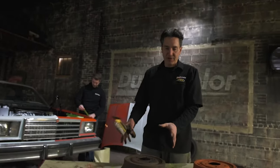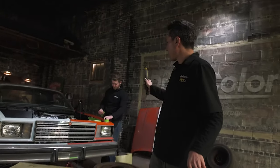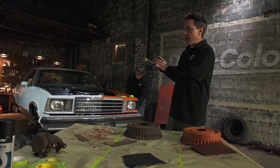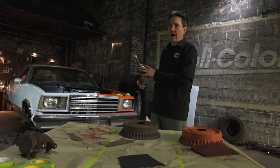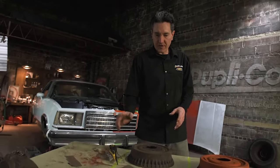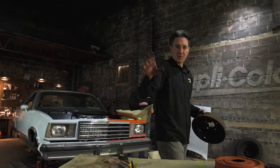I'm finishing up this brake drum. Ben finished scuffing the other one down so that one's good to go. He's over there masking off the whole area — the framework and all that — because we're going to paint the caliper on that side of the car. These drums are pretty much ready to go, so I'm going to grab the air hose, blow them off, and clean off our station so we can get these things painted.